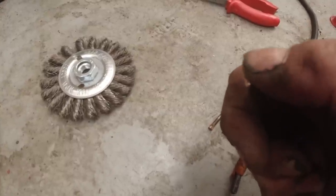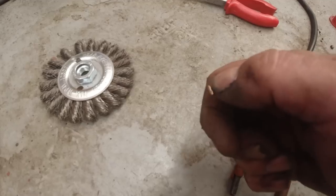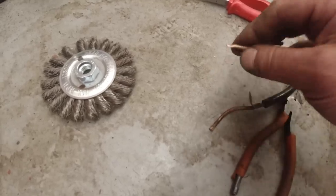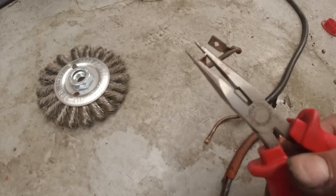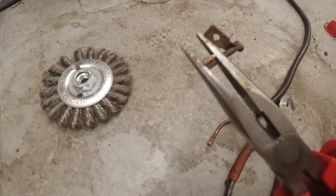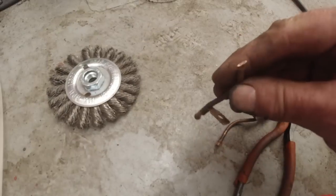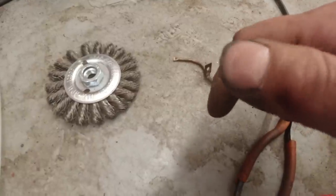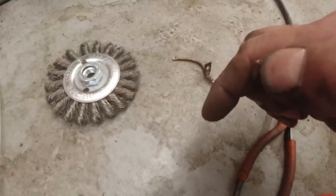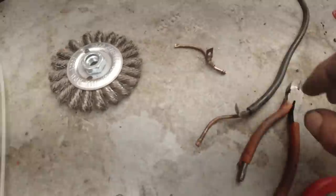And I was struggling to get the zip wheel through it, and I thought there was something metal jammed inside it. I tried all sorts, and eventually I decided to just reverse crimp it like this. I just squeezed it a little bit, and that enlarged the eye, and then it was clear. So that one was a bit damaged at the end. I don't know how that's happened in its life. But both those now go, blocking one, blocking the other. So we're done there. That's a little tip for you.